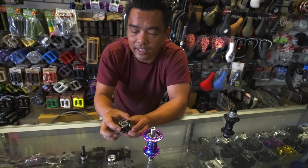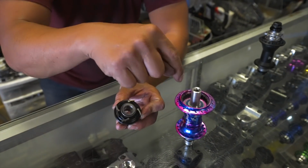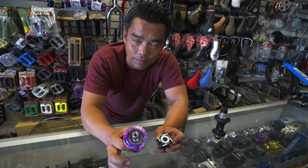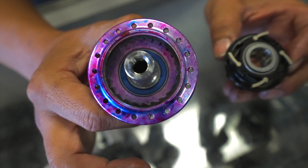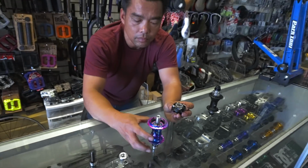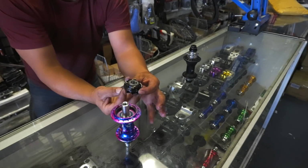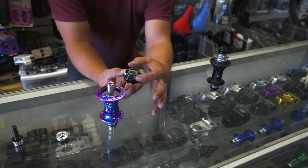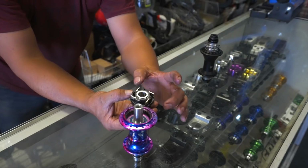So 4 of these things, when it goes down, it collapses and it pings out, all 4, ping, ping, ping, all around this ratchet system. Look at it, look inside. You see that ratchet system, can you see that? So when it goes, it catches, and this thing pushes, propels the hub. And every single time you stop pedaling, the ratchet system collapses it, and it catches it again.